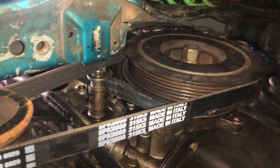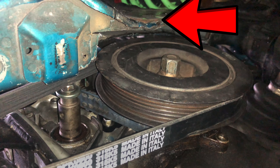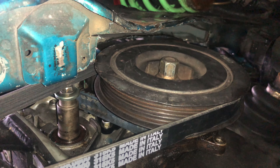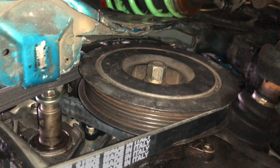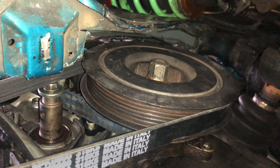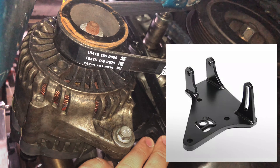If you decide to run this manifold, you're gonna need the 1320 H2B spacers because your hood will not shut — it will not shut. You will crack your MAP sensors. I cracked three of them, so save yourselves some money: do not shut your hood without the spacers.